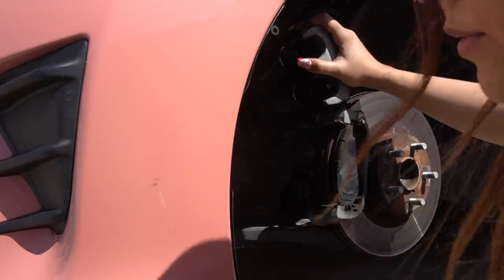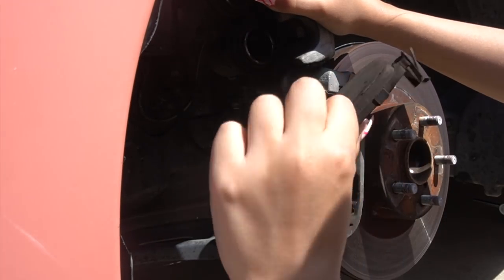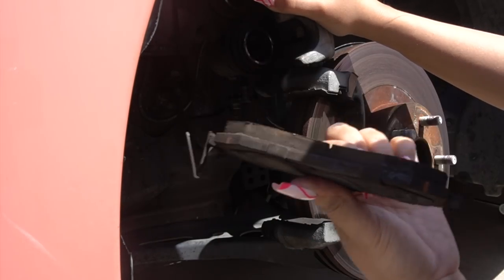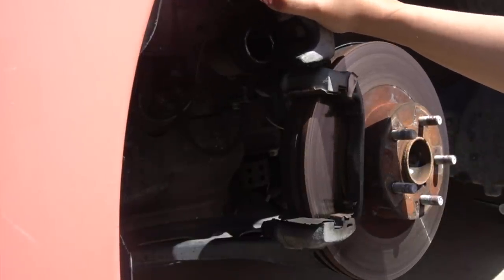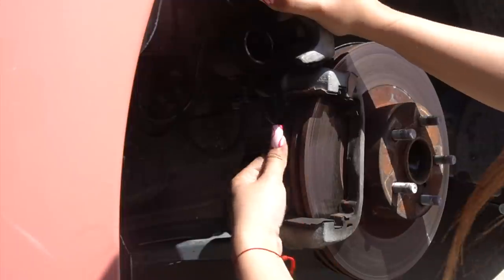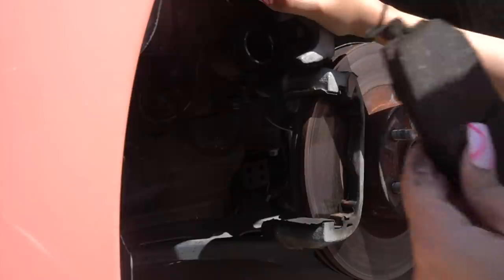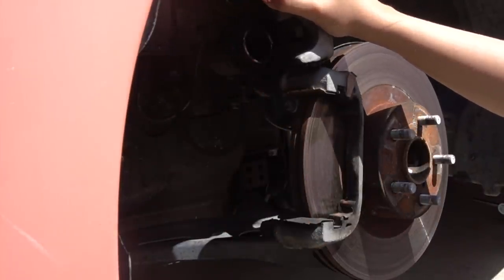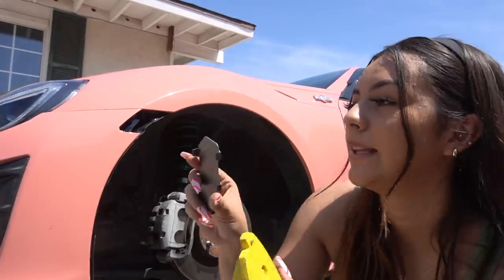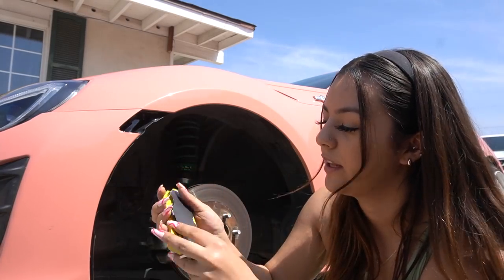You can literally just take this off with your hands. I guess there's still like enough left but I don't know. I probably should wear gloves doing this honestly. So these are the pistons that I need to compress and I do have a C-clamp for that, so I'm just going to be doing that after I put in the new ones. I figured out where these little plates go — they're just going to go in the back of the brake pad and just kind of clip in.